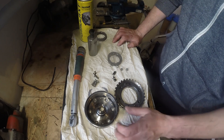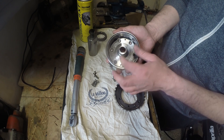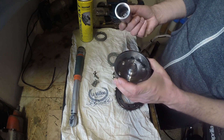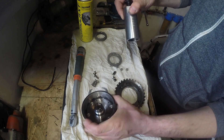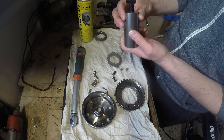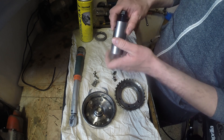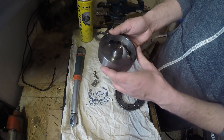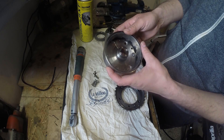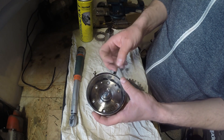First thing that had to be done was to unscrew the nut which was here. Take off the nut and the washer. Then apply the puller like that. After this one is fully tight, just hold this area with a spanner — like 32mm as I remember correctly. Then just spin this screw to release the flywheel from the crank. It is done that way because it is a tight press fit, so you just cannot unscrew it and take it off — you need to pull it hard.